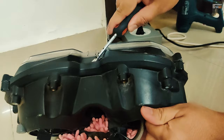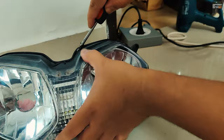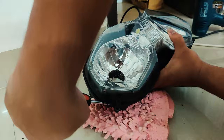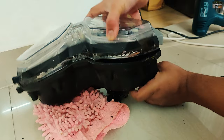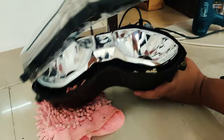The downside is it's a long process that requires a lot of patience. If you exert too much pressure, something is going to break — either the glass or the backing plastic — so we go really, really slow. Going steadily around the whole perimeter of the headlamp, slowly prying out the glass, the separation process was eventually completed and the glass was successfully separated from the housing.